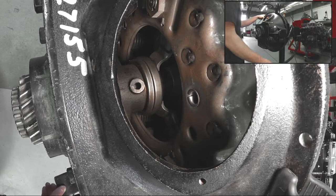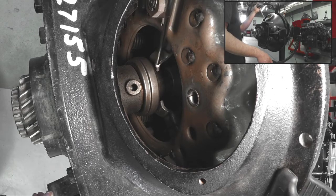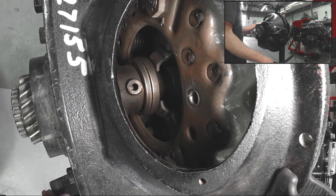This would be your normal free pedal that you would see inside the cab. Now, as the clutch wears, those release levers make contact with our release bearing, and that will result in continuous wear of our release bearing. So it's important that we maintain our linkage adjustment so that we maintain our running clearance.